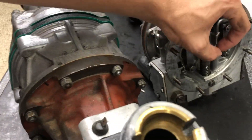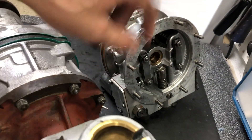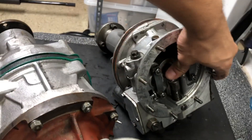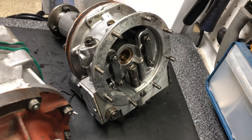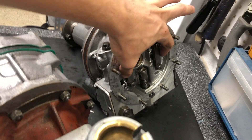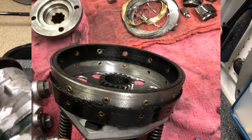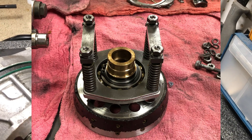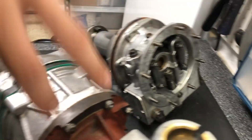The J-type has a ring that the eccentric on the transmission itself actually pumps that center valve. The D-type uses a spring, and the spring runs on the eccentric. There's the brass in the middle — the pistons that are behind here are attached to the clutch through these retainers. Those pistons are smaller on the D-type than on the J-type.